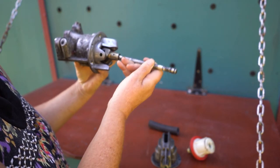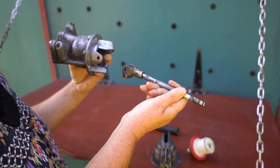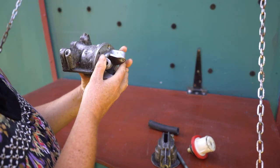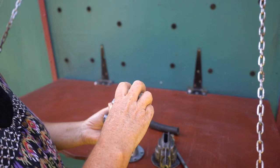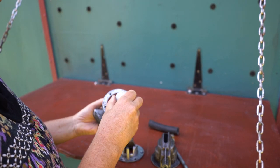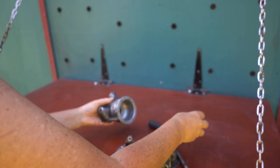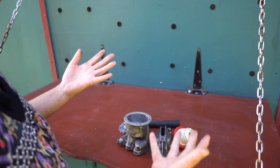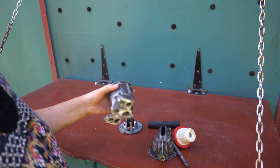It's really important to take this lever off — the one with a pin through it — so that you don't rip your whole handbrake apart. The spring is massive — like really, really big. Once you've taken all that off, then you can undo the rest. They're quite a complicated thing for something simple. This one's been taken to bits so it looks a little different, but yeah, that's what they are.